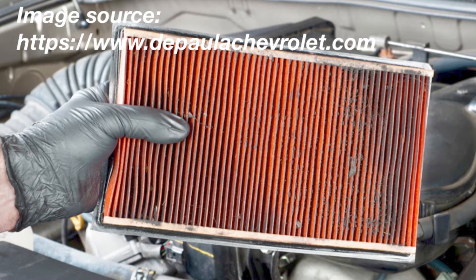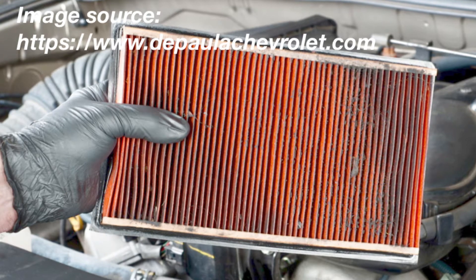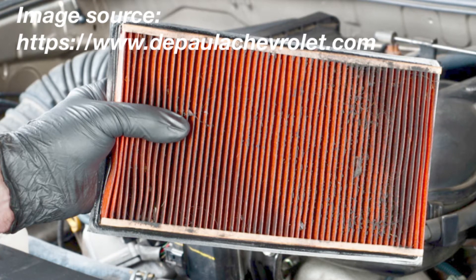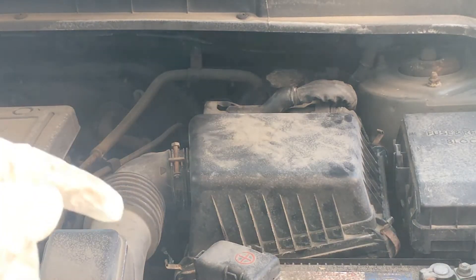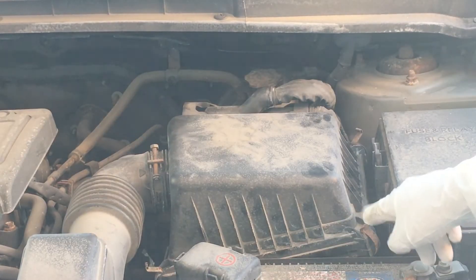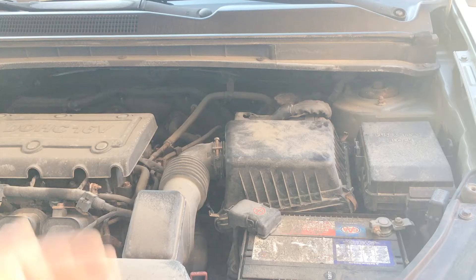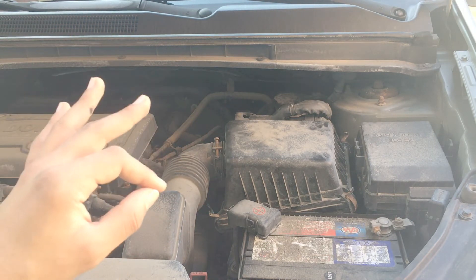Because it would be more difficult for air to penetrate through a clogged filter, this would reduce your throttle response, acceleration, and the overall performance of your engine. In order to prevent this, it is recommended you change your air filter every 20 to 25 thousand kilometers as regular maintenance. This is probably one of the simplest things you can do to your car — unscrew your hose clamp, undo the pegs holding down your air box, remove your air box, take out your old filter, and drop in your new one. It's a very simple process; anyone can do it, and it's a great way to keep your engine running smoothly.